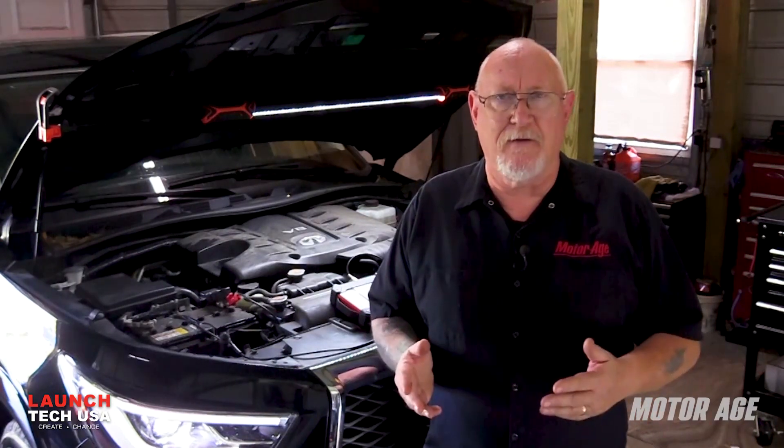Those settings will help you capture just about anything on the vehicle related to the 12 volt systems. It's based on the fact that at those settings, there's enough time on the screen to capture 720 degrees of an engine's revolution at warm idle. In this case, the test I'm going to make will be at cranking speed, which is significantly less than warm idle, so I need to adjust the time base accordingly. Let's set it for 500 milliseconds per division.